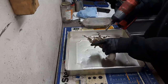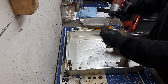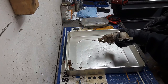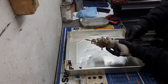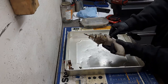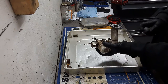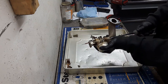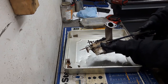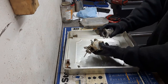I've got the carb up on the bench. First I'm taking off a small bracket with two quarter-inch fasteners. Then I'm separating the intake manifold from the carb itself — it's a Phillips screw with a 7/16 nut on the end. The nut isn't turning so I can just take those right off, being careful not to rip the gasket between the intake and the carb. There's the gasket — it looks okay.